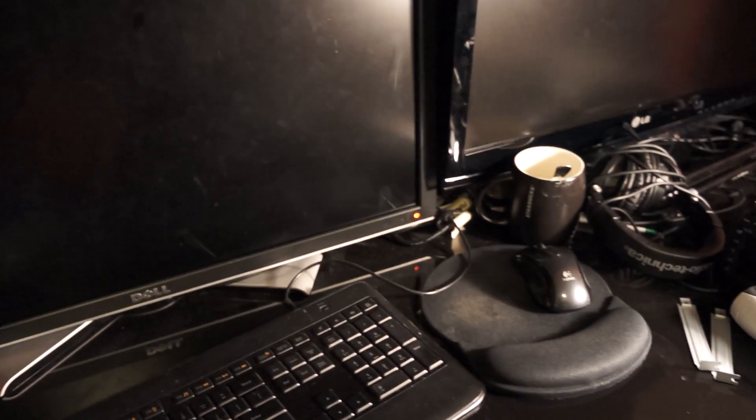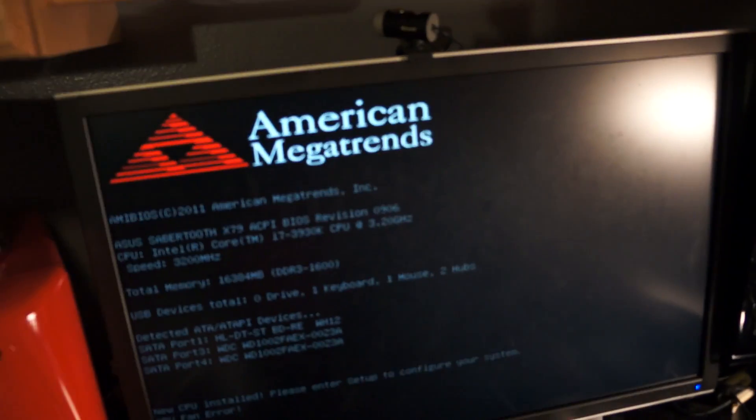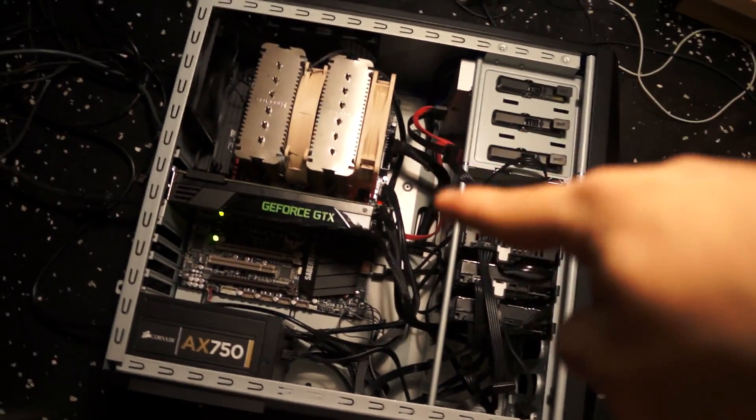Just give me a sign. I saw a blink over there — ooh, whoo hoo! Yes! You did it baby, good job! You just put together our computer all by yourself. I knew it guys — I saw a little blink in that case, a little bloop, and I knew that was my blink of hope. Oh — new CPU installed. CPU fan error. So we looked up issues with this fan and people said they had the same issue with the CPU fan error. If you get that error, just turn off QFAN in your BIOS and it works.